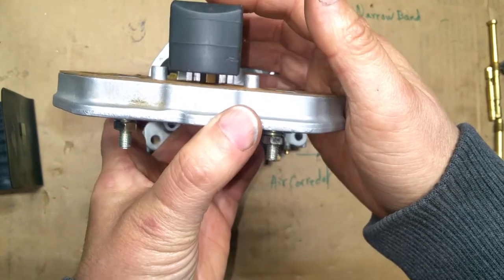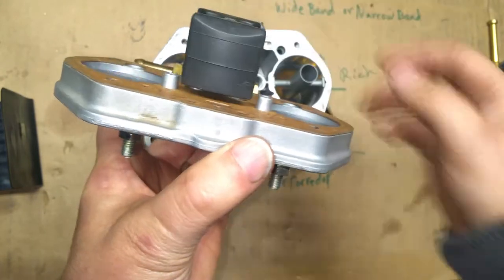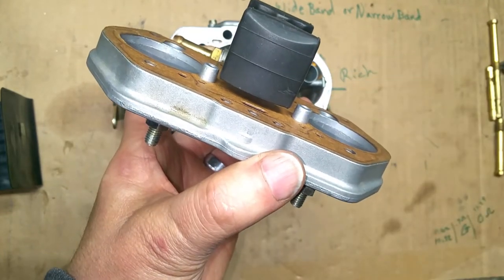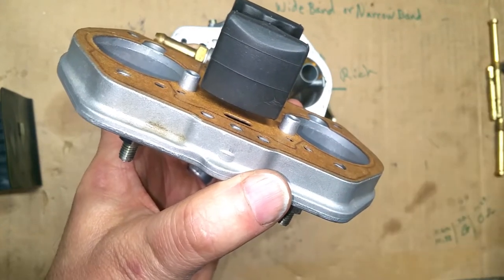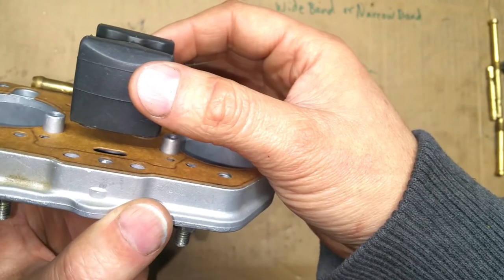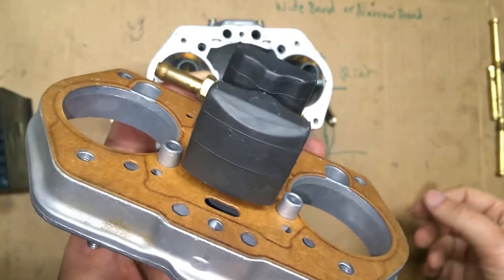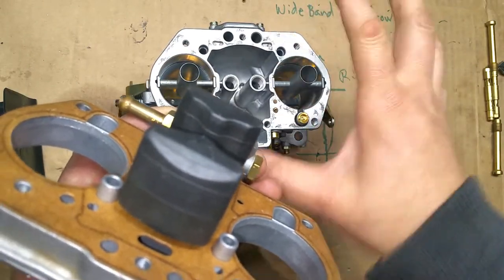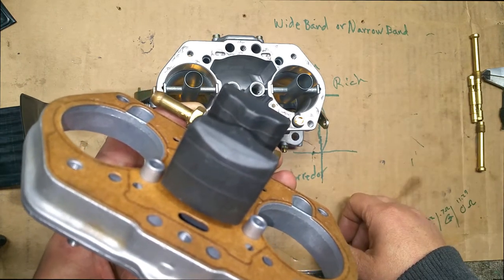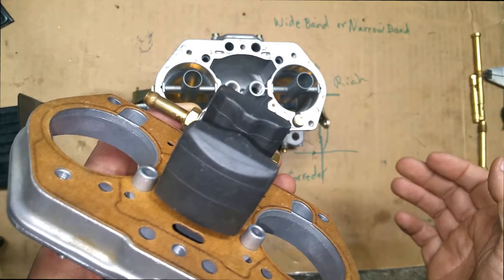If you guys were paying attention to my channel, you'll remember that I said my fuel bowl level was somewhere around the middle of this little nub — the very bottom edge. The very top of it is six millimeters. What I did is went back to six millimeters, and I think that's where I can get to the rev limiter real quick. Before, I just wasn't getting there. The carburetor wasn't happy with my 32-millimeter venturi. So I went back to that, but I'm still running rich on my cruise — or too close to rich. I'm inside stoich by a hair.